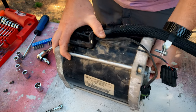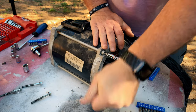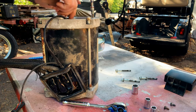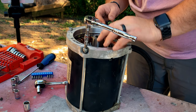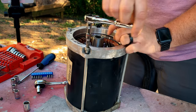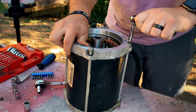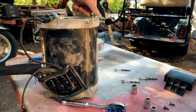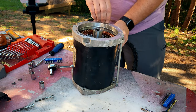This armature spins no problem — it's got a little grease I put in it last time I took it off, so that all looks good. You want to make sure that the teeth inside this and on the gear on the differential are not torn up, because if those teeth are eaten up the motor will spin and kind of jump gears. These bolts are all the same length, same thread, same everything, so it doesn't matter if they go back in the same holes. You just want to make sure that you hand thread them before you impact them.